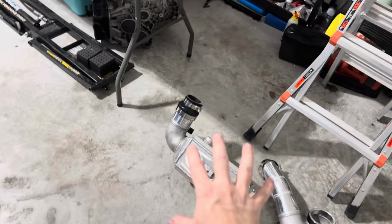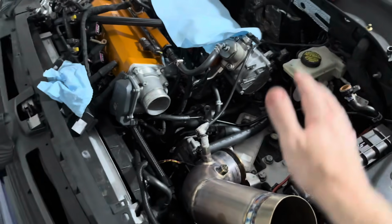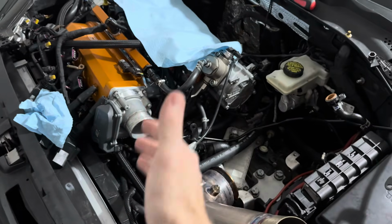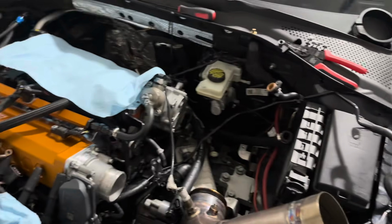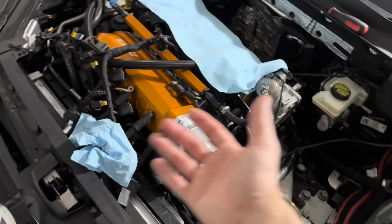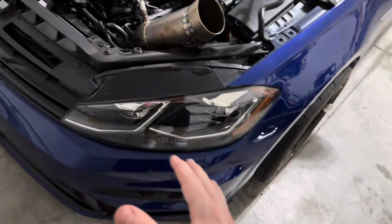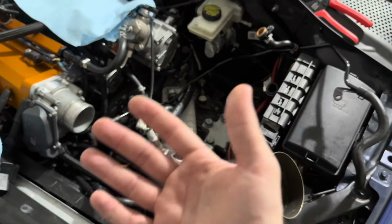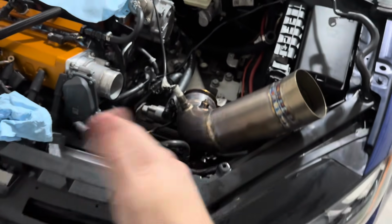Anybody who knows these cars or works on these cars, and all of the big guys, I'm sure their IATs probably start at 100, maybe 120, and end anywhere between 140, 160. You know, 140, 150, it's a bunch of cylinder pressure that's not needed. I'll be able to make more power off this without the extra cylinder pressure. And so it goes back to my other video, or the previous video, where I talk about rod to stroke ratio, where the sleeves are needed, and so on.